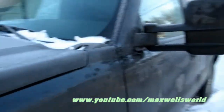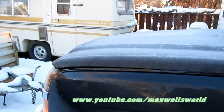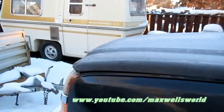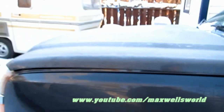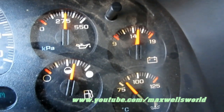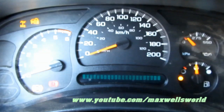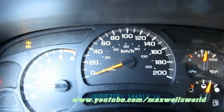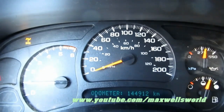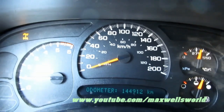With my experience on vehicles, if it was a bad alternator and the battery's dead, the truck shouldn't run at all. But if it's a bad battery and the alternator is charging, the truck will still run — though it's not good for the alternator. Looking at the battery gauge inside, it's pulling just a little over 14, maybe 15, on the battery meter scale. And if you shut it off and restart it, it restarts good right afterwards. But if you wait four or five hours after a break and come out to start it, it's slow starting again. So that tells me the alternator is working good — it just needs a new battery.